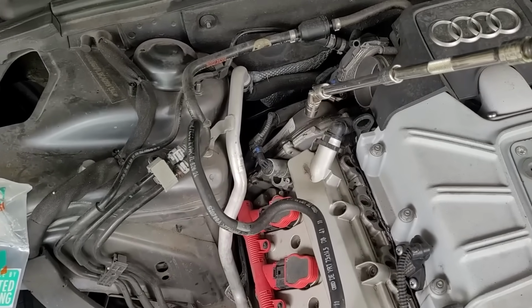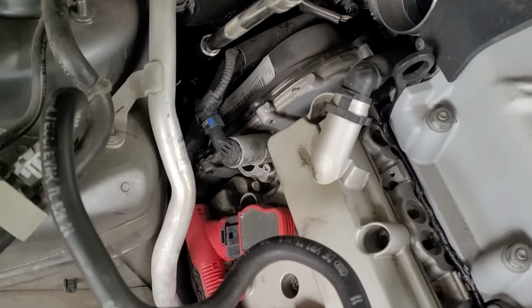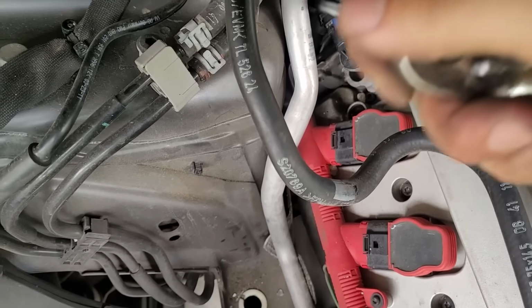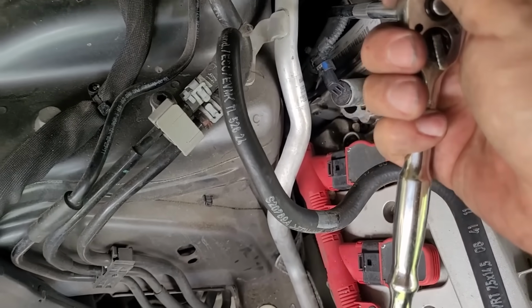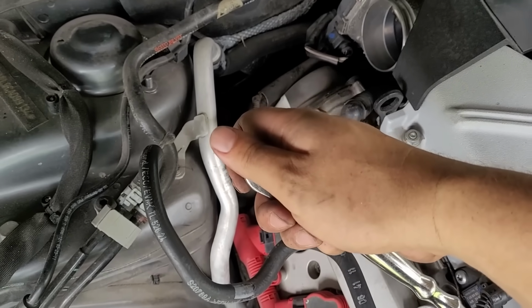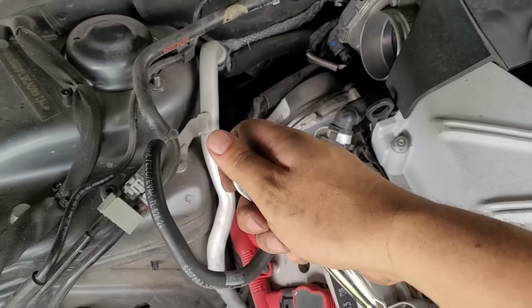Get to the last nut that is holding the frontmost pipes up. We've got a ratchet on an extension with the swivel, really long. Sage is underneath, and we've got the air intake out. We've got the rooster chasing us at the same time, so we got to do this quick. Just gonna try and slide it on the nut, and we're gonna get it from up top, and if we can, it will make this exhaust install a breeze.